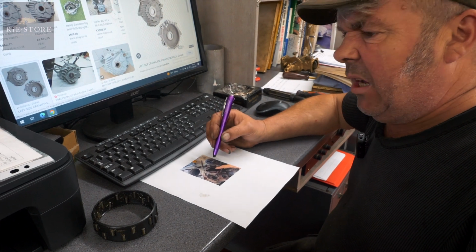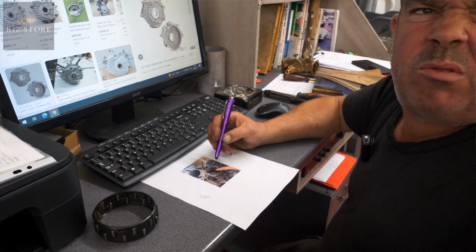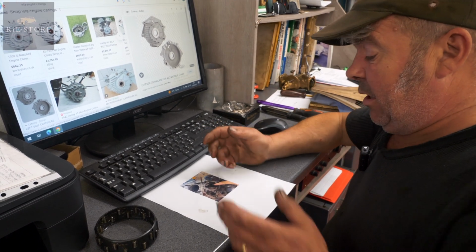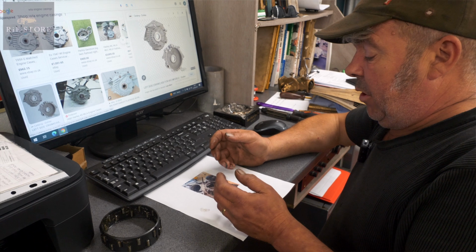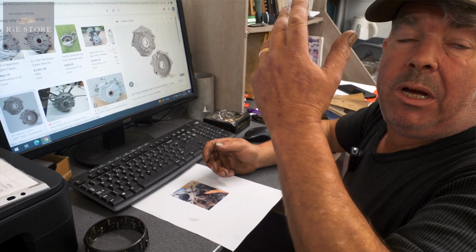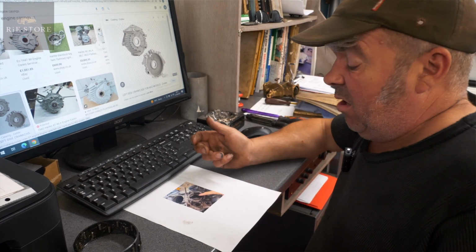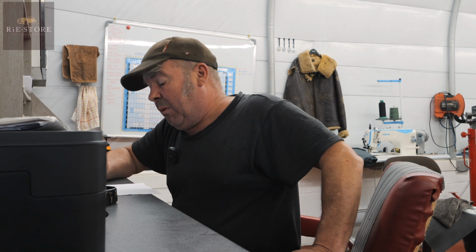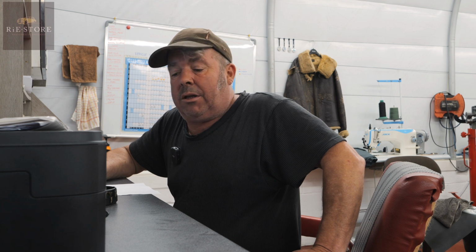I mean, the Indians, I think, had a plate on them, or a bit of mesh or something, I can't remember now. Anything that will cover that hole, like I say, it's not going to affect bottom crankcase pressure or anything like that. It will just literally throw more oil up into the base of the bore, and you get an oil build up and it'll probably smoke. So yeah, I've just put a little plate in there. It hasn't got to be liquid tight, you know what I mean? It's just to stop splash going up through there, that's all it is. Damn. Cool.